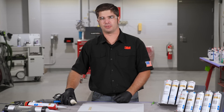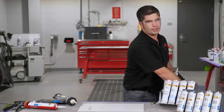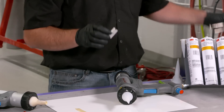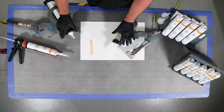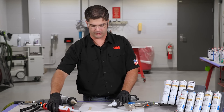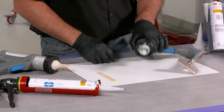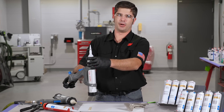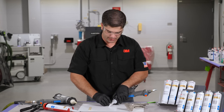As you can see here, I've been using our beige seam sealer, but what I want to show you first is how we're going to accomplish that look. We're going to start with a couple simple things: a razor blade, vise grip pliers — if you're using our sausage pack offerings, or we can do this with our single cartridge offering as well. What we're going to be accomplishing here is cutting this tip at about a 30 degree angle. You really want to be careful here not to go too far, because this will affect the look and appearance of the bead.